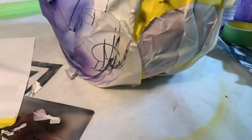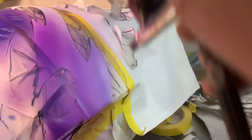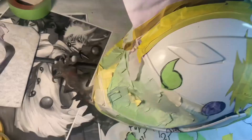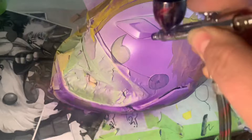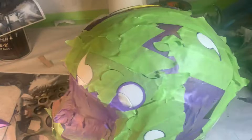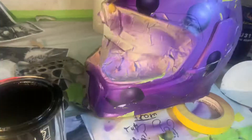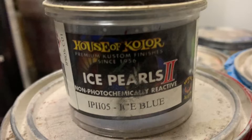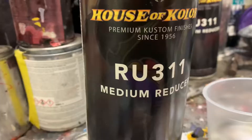This right here is my divider graphic to split up the two colors on both sides of the helmet. I'm using some clear base and some House of Color ice pearl — mix that up and spray right on top of the image. In low light you still see the graphics, but when the light hits it, it has a real pop of metallic to it.